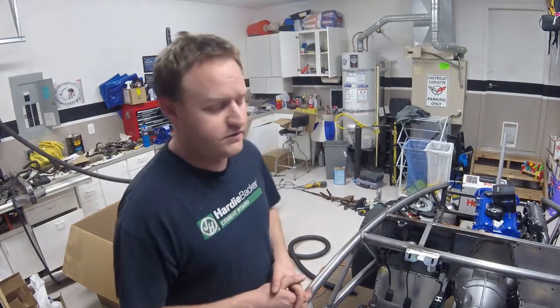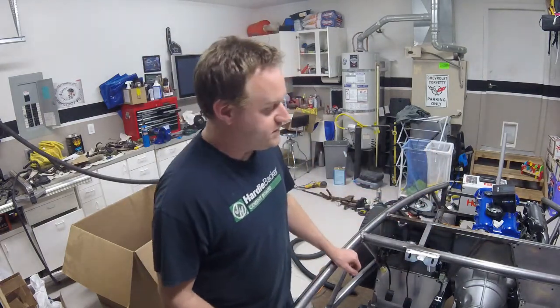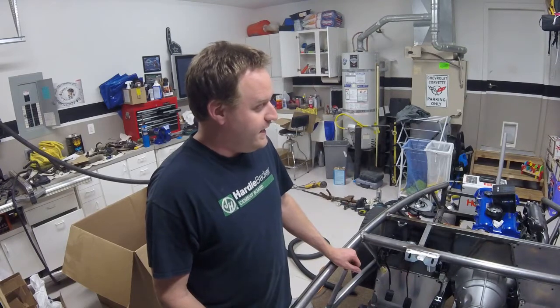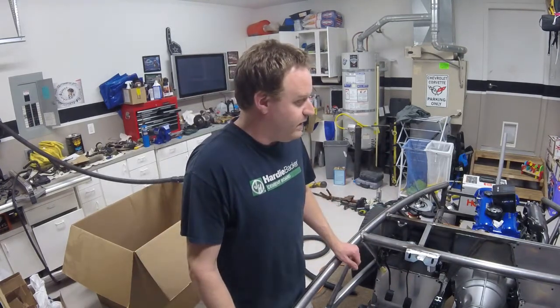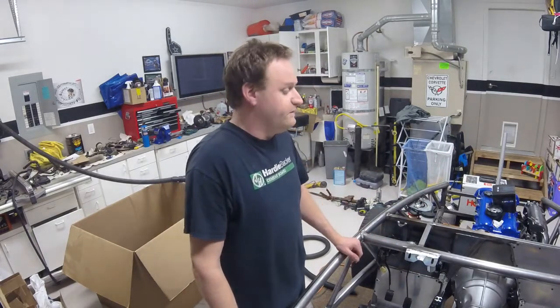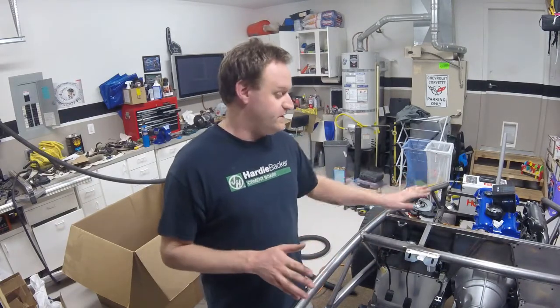The stainless lines ran about $170, and the fuel injection hose is right around $4–$5 a foot — it's not cheap, so make sure you get enough but not too much. In the future if I go for more power, I'm going to pull that fuel rail and get a nicer one that does have a 6AN fitting on it, so I can extend the stainless lines all the way up to the fuel rail. For now, this is the way I want to go to get it started. Thanks for watching — if you like the videos, please hit the like button and subscribe.